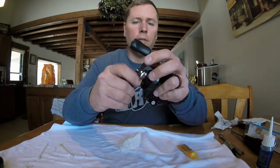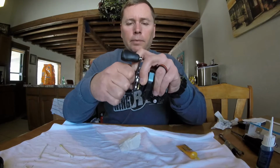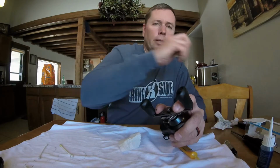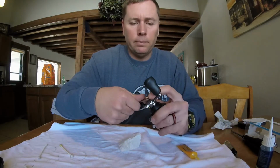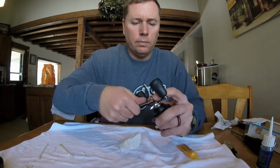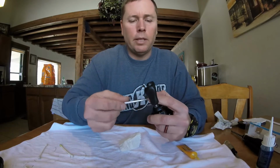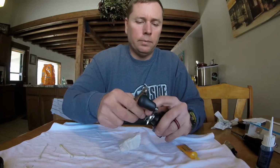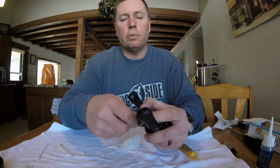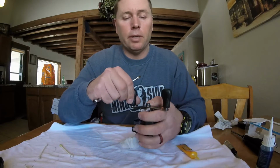Alright, once that's on, you can tighten your drag on down. That'll give you more room to crank your nut down. Then you put your wrench back on it, 10mm. Get her snug. Don't over tighten, because see, I can still do finger tight here. She's still going on. Okay, you just want her snug. Remember, there's not a whole lot of teeth there for this thing to grab.